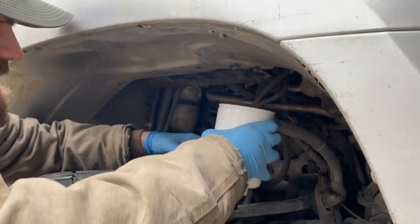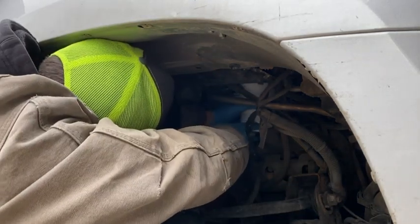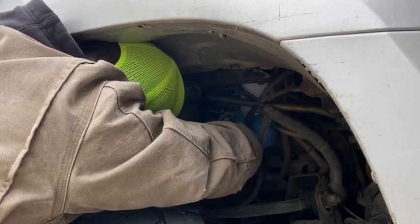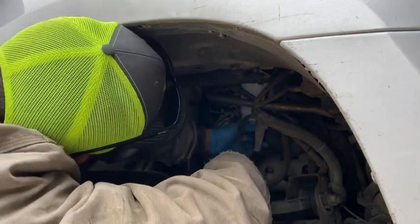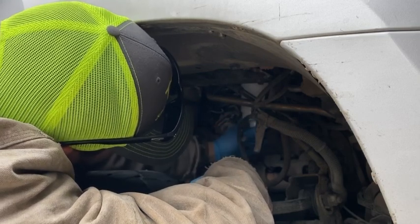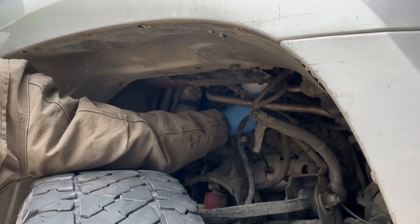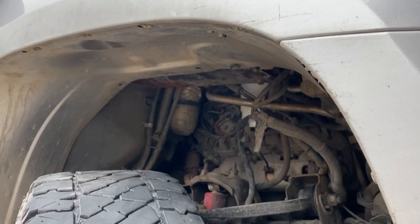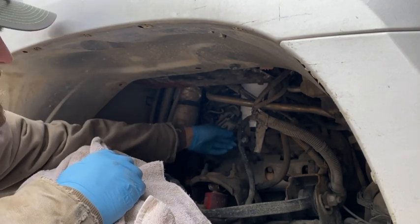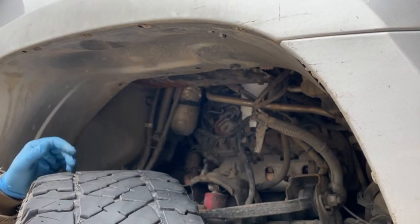We're going to spin her back on. It always pays to look up in there and check your mating surfaces, just to make sure everything's good — you don't have extra gaskets or anything in there. Because unless you've been doing the maintenance yourself, you never know. Now that that's in, we make sure we plug our water separator in. And that's done.